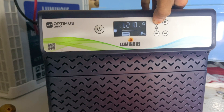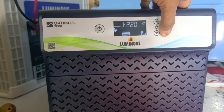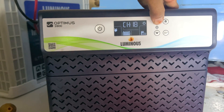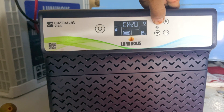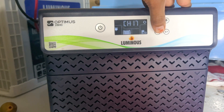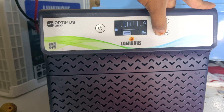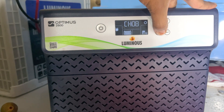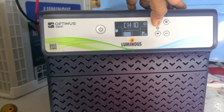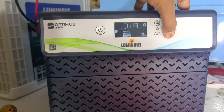If you have a 200V or 240V input, you can regulate it. You can see the advantage of adjustable charging ampere — charging ampere speed can be selected. If you have a 20A or 15A charger, we can select the charging ampere. The minimum is 8A and the maximum is 21A — 21A is fast charging. Normal charging is 16A or 18A. With two batteries it will be 18A.